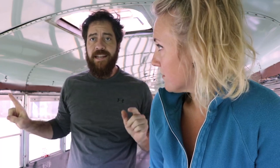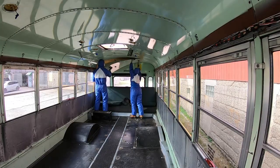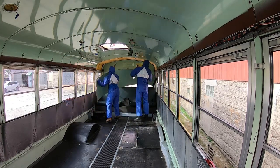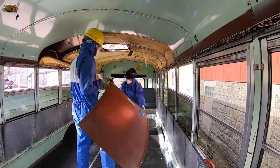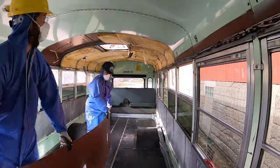We're going to need probably a screwdriver because all of these panels are curved and sitting right over here on this ledge. There's a little metal ledge that comes out that the panels are resting on on both sides. So we have to pop that out and one side will come down. There is yellow insulation up in this roof, so we're going to wear respiratory protection - a particulate mask - and the blue suits.